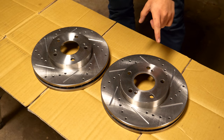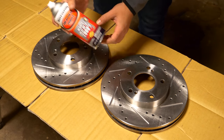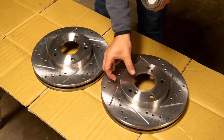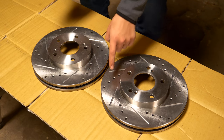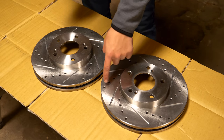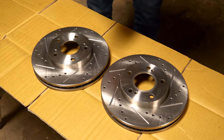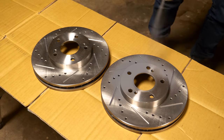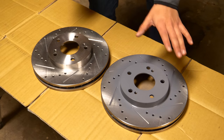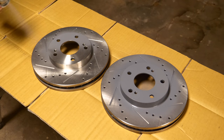With the brake rotors now cleaned up, we're going to start off by putting a little bit of high heat primer on the top hat of the brake rotor so that the paint will adhere nicely and stick. We don't need to tape off the brake rotor contact part because as soon as we use our brake pads, it's going to wear off. Many brake manufacturers come with pre-coated rotors and are pretty much doing the exact same thing. Just grab your can of primer and spray a light coat onto the top hat. Go with a light coat first, let it dry, then come in with a second coat. Repeat this procedure to both brake rotors and then let them dry while we get working on the calipers.